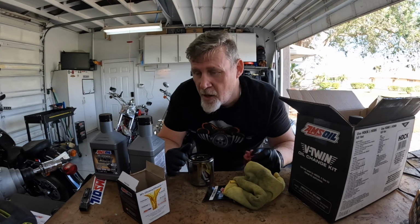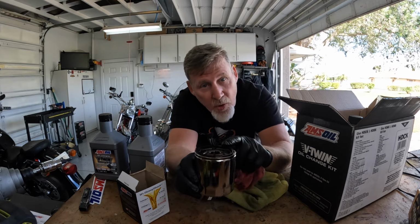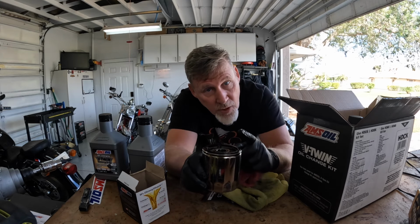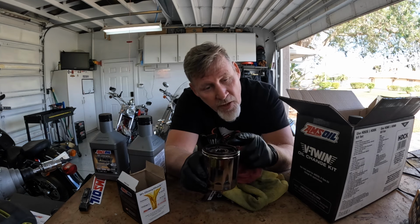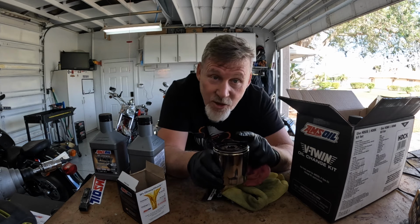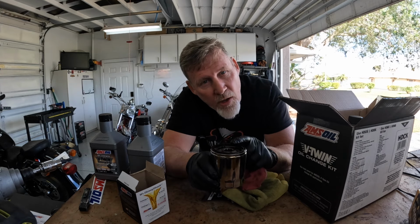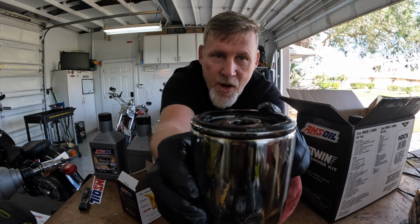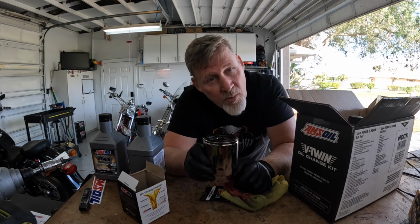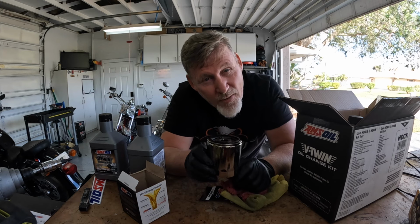All right, guys, quick tip. I would call it a pro tip, but as I said, I'm not a pro, so we're going to call it a bro tip. Anyway, when you pull off your oil filter, make sure that the old O-ring is on the oil filter. Sometimes they will stick to the motor, and then you just throw on the other filter, right? And in this case, two is not better than one. The two gaskets will not make a good seal. You'll fire it up and it'll spray oil everywhere and you'll have a mess to clean up. So make sure that the old rubber gasket is still on the old filter before you put the new filter on. Just a quick bro tip, it'll save you a lot of mess.